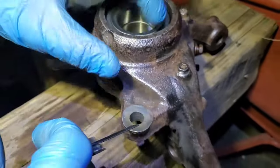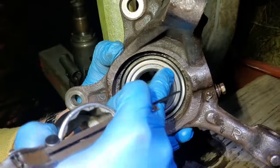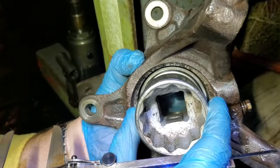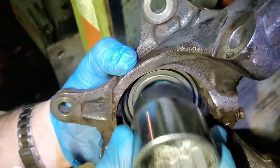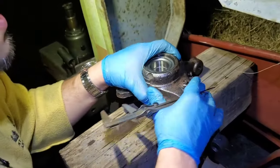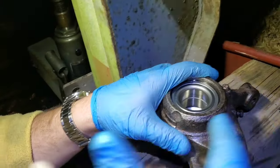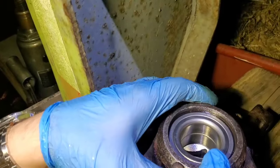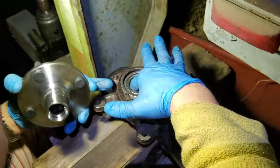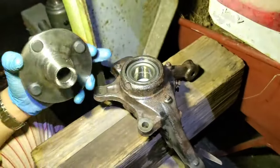And you wanna make sure when you press, why do we have this on the bottom? We wanna make sure that it sits right on this side of the bearing. Otherwise it's gonna break it. Yeah, it's gonna push it off. You wanna make sure it's there, like so. Exactly perfect, you know what I mean? Otherwise you're gonna break the new bearing. You wanna make sure that everything is evenly perfect. So we're good, we measured it. Make sure it's all good. We're gonna make sure it's lubricated well. Okay, you're good to roll.